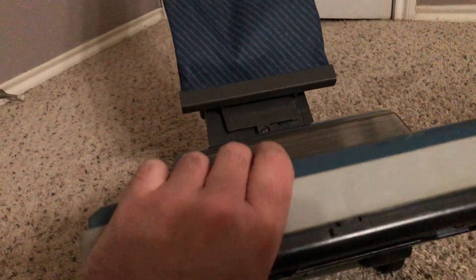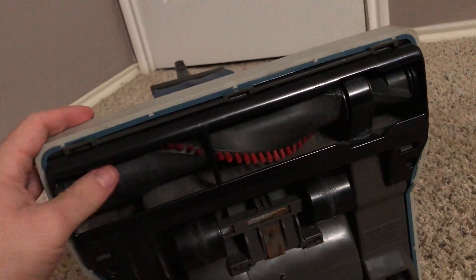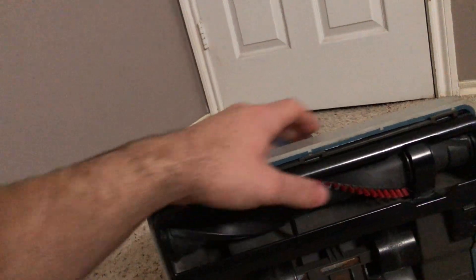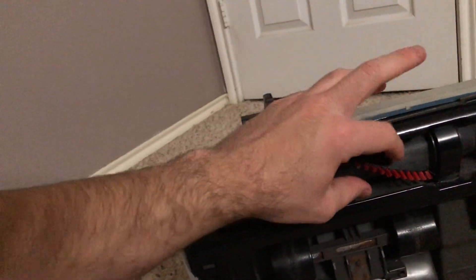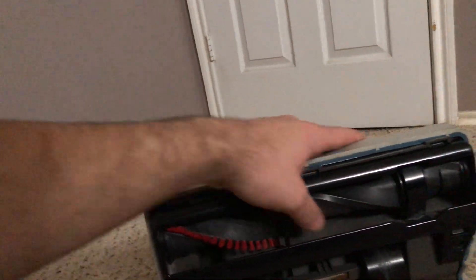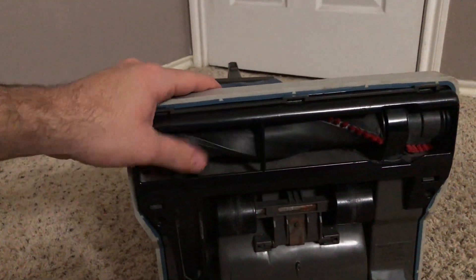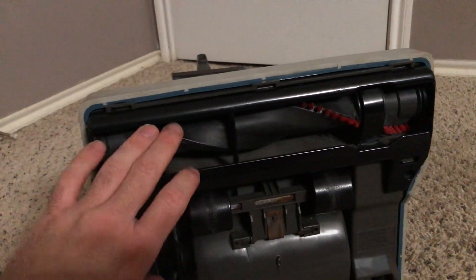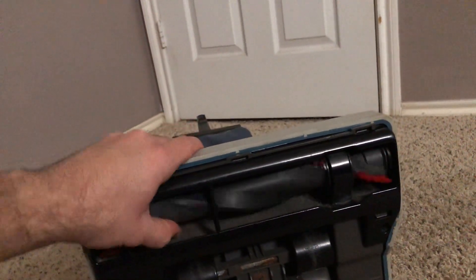Let's take this back to show you the underside. Here is the brush roll — it is the original style red bristle single-row brush roll with medium-stiff bristles. They are not the stiffest of bristles, but they do work very well. Even though it has one row of bristles, the blank section can potentially act as a beater bar on certain carpet piles, but this actually still has decent agitation for being a single row. It's actually pretty good.